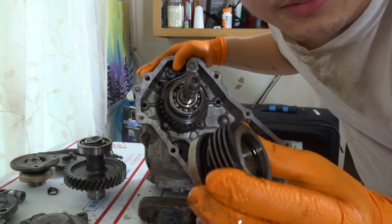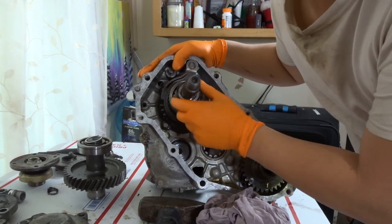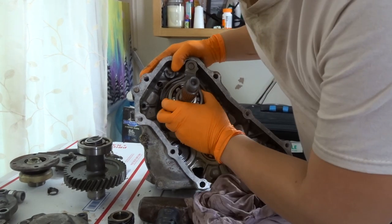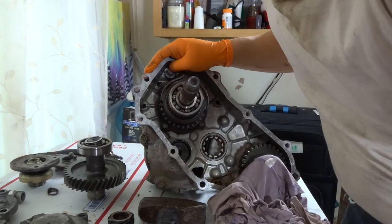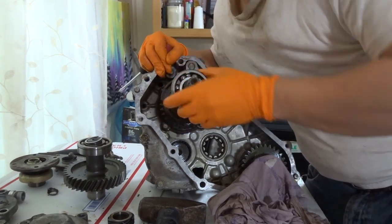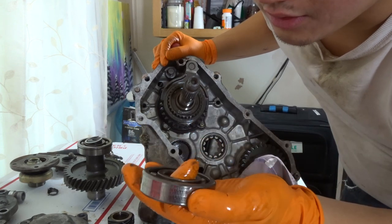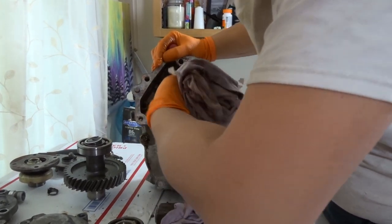This is the Oil Pump Gear Drive — it looks like that. You have two sides and this side goes in first. Step number 8 is to remove the 6308-2RS rear main shaft gear bearing. This bearing pops right out with no effort. I can tell these are the original bearings because they still have NSK, which is a Japan bearing — they're really smooth and feel really good, so they might still be good.